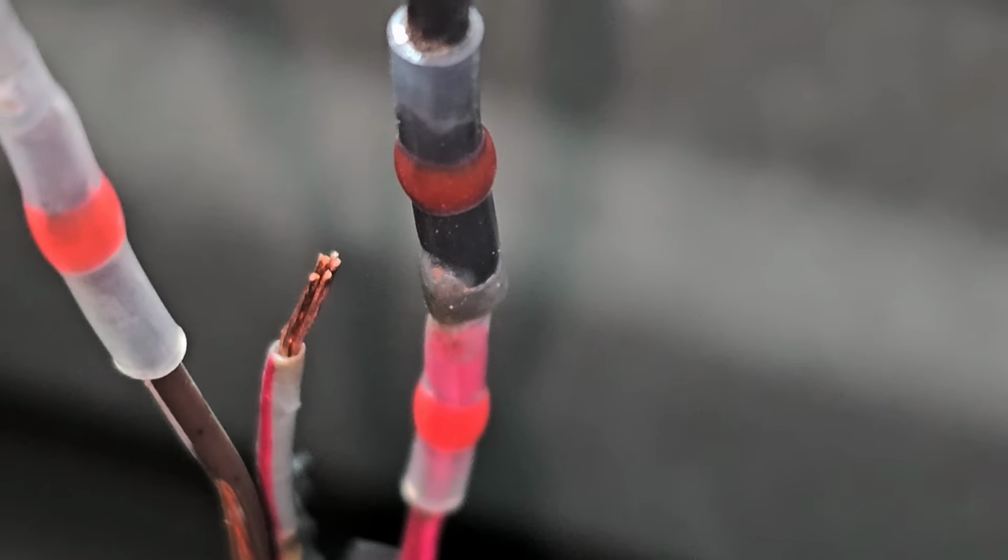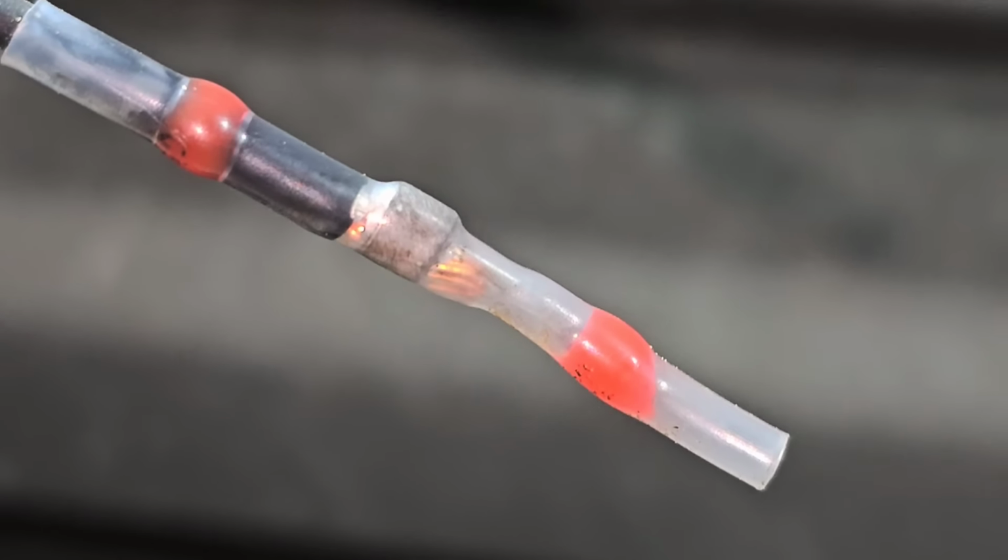Okay, not surprising one bit to me. So here I am checking a connector pin diagram, the connector itself, just to make sure that the wiring was done correctly. So I'm up here, and I'm reaching into it, and I'm pulling on the wires as I'm checking them to make sure I got the right wires going into the right position. And guess what? One wire pulled right out. So as you can see, by looking at the wire, the solder never made any kind of a connection. So how good are these things? Seriously.